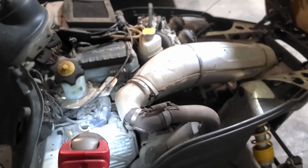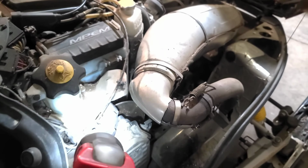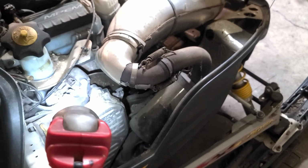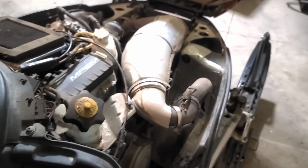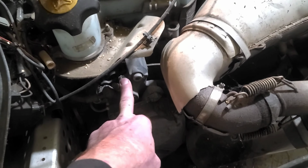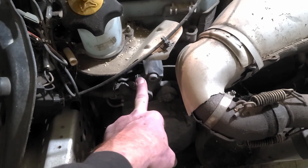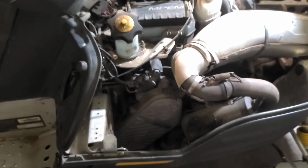And then check the brake. Have a look at it. Yeah, it's rusty from sitting, not a big deal. I find sometimes with these old sleds, you gotta deal with the brakes. That's pretty important because if your brake hangs up, it gets hot and you can light it on fire. If that gets smoking hot and you don't notice it, and usually with big sleds, you don't notice it as easy because they got enough torque. It's not like slowing you right down.